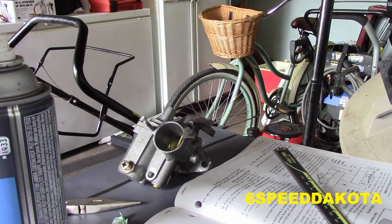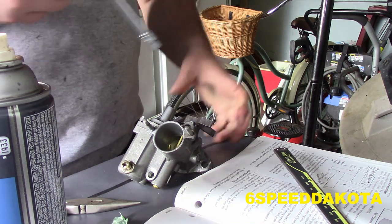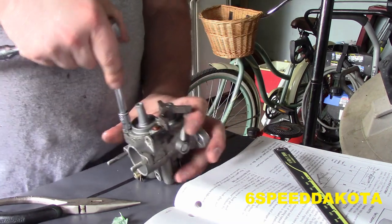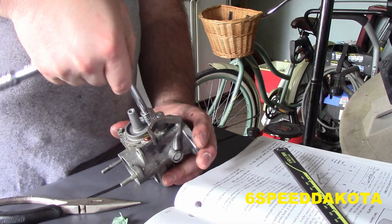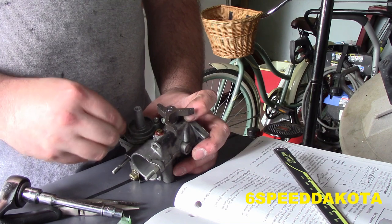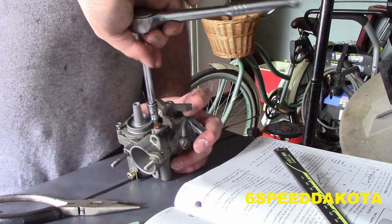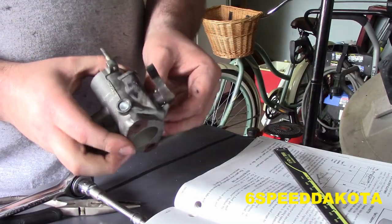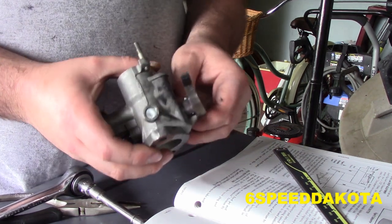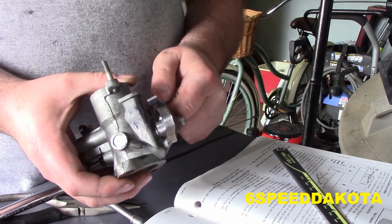So, you need a quarter inch socket, and that will remove the two float bowl bolts. Now, the main thing I'm trying to achieve with this is I'm just trying to reseal these, because these seals are almost 50 years old. And since we're rebuilding the engine, may as well. I have had the carbs apart before, and they're not, like I said, not complicated. I have replaced the needle and seat before, and so we're just doing it again.